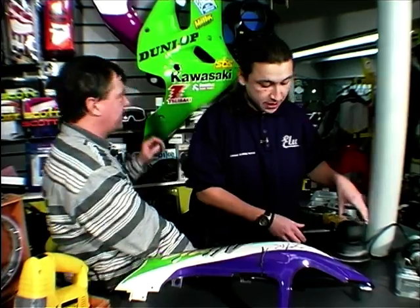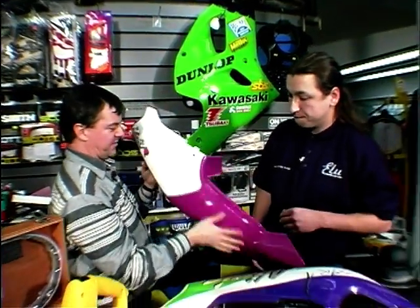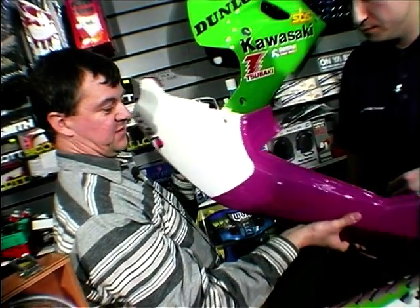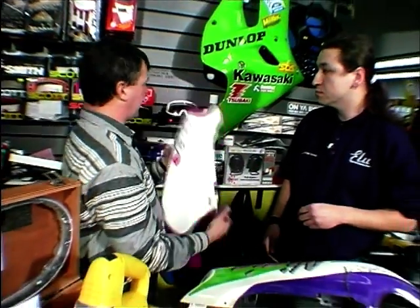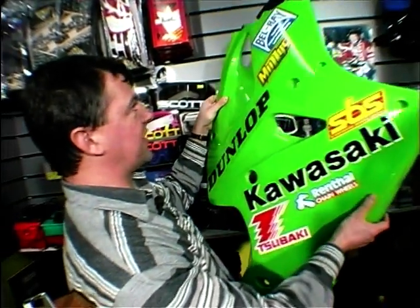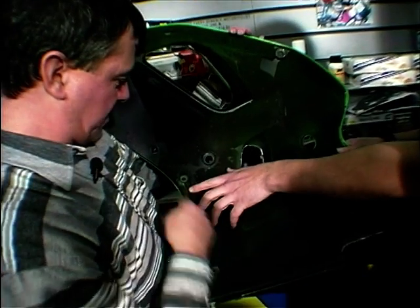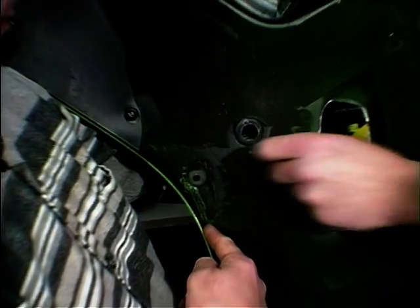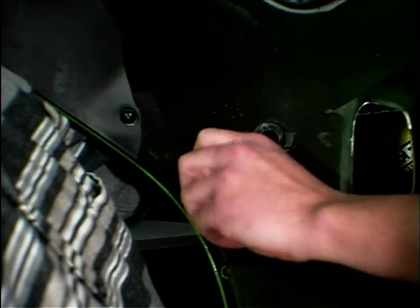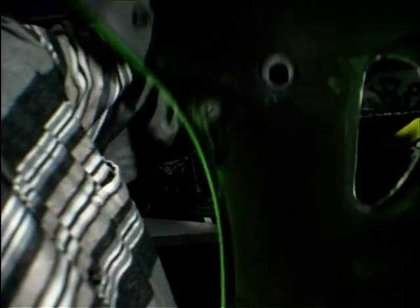Now there are some clever lads at painting, aren't there? Because I happen to have one here that we made earlier — this has been painted by a local body shop. Beautiful isn't it? Better than original really. I just happen to know this has actually been repaired and you can't tell — where is it? I haven't got a clue. I can show you on this fairing panel where it's been repaired — this is as original on a ZX9R. But on the inside — there we are — this has all been filled in. The lug's actually broken off, so he's packed it all up and filled it up, much like we've done here. And it's really really strong — stronger than the original, because there's more material and it's the same material.